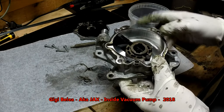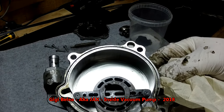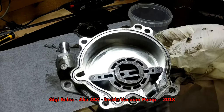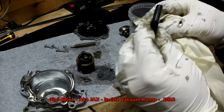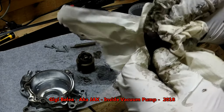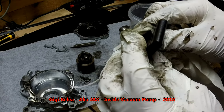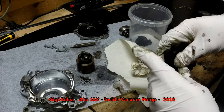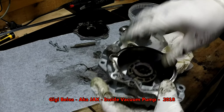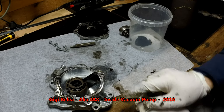As you can see, this one has a lot of wear — it has rubbed a lot against the wall and was not making vacuum as good as it should. Let's take a look at the blade — I don't see so much wear on it. Now we have it open and checked, you can see how it looks. We can assemble it again and that's it for today. Thanks for watching guys — this is a vacuum pump for a Volkswagen Audi.